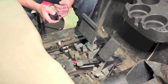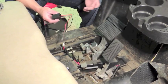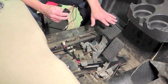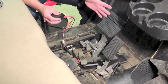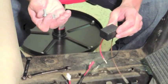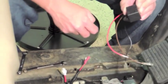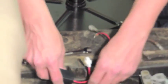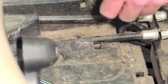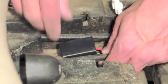Just a little explanation as to why this is used: on a gas car, when you set your brake, your brake switch is constantly activated. If you left your car for four days without this time delay, the brake light would stay on. What this does is when you set your brake and walk away, it allows your brake lights to stay on for one minute and thirty seconds to two minutes, then turns the brake lights off — a safety feature so it doesn't run your batteries dead. The LGT142 comes with a quarter-inch 20 bolt and a serrated quarter-inch nut. Put your bolt through the mounting tab on the brake time delay. There's already a quarter-inch 20 hole here — sometimes it may be a little tight, so you can run a screwdriver through to open it up, or use a quarter-inch drill bit. Usually you can just push the bolt right through.